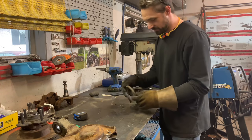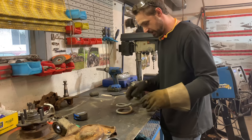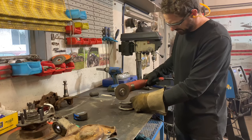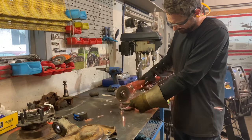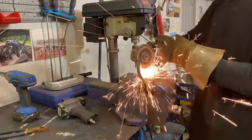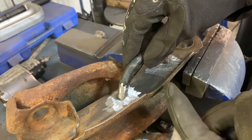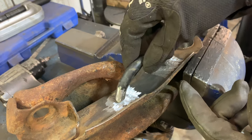I just use old springs for the tow hooks — I've been using this old one for everything and this is kind of what's left. We're going to chop it up and make a tow hook out of it. I really ground down the edges so I can make a couple passes and get a good fillet weld in there — nice and strong.